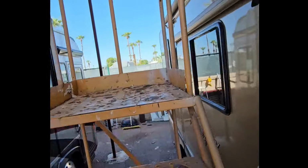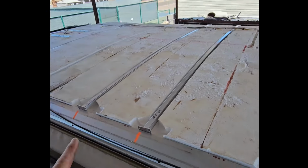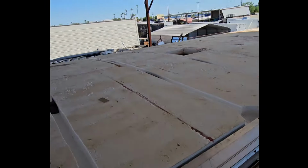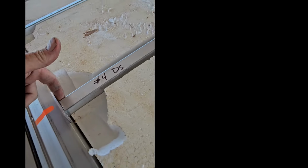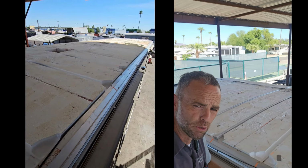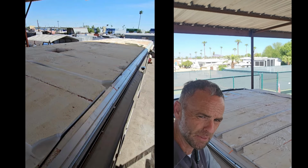And they're making 13 of those bow frames because this Winnebago roof has already been replaced by a previous repair center and they did not do the job correctly. And now the guys here at Cassone are going to do it the right way to make sure it doesn't collapse this time. You can see right here they make these flanges, they'll weld those onto those frame members, and now we'll have a perfect match to the profile in that foam. And that way when they laminate the Winnebago roof, it'll be done correctly and it won't collapse like the previous attempt did.